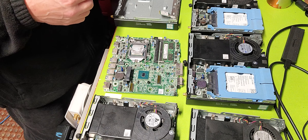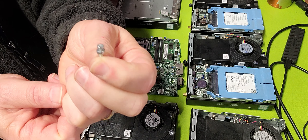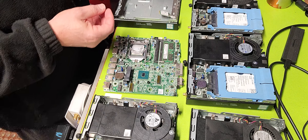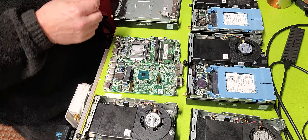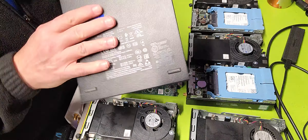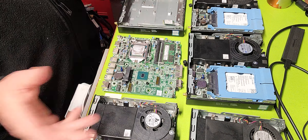Double-headers — you probably wonder what that means. Well, this is a double-header: it is a normal size screw, but if you look at it, it has a smaller screw screwed into the top of it. This is used to secure your Wi-Fi module and also allows you to hold down the M.2 drive via the sub-screw. This chassis housing does not show any indication of an auxiliary screw, so make sure you don't displace your screws. These three screws are specialized — it's going to be the same thing with an HP mini desktop or a Lenovo. They're proprietary — not like an ATX case.